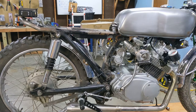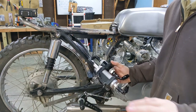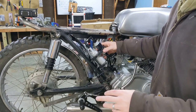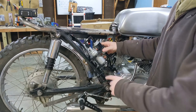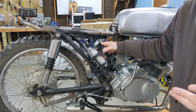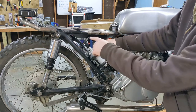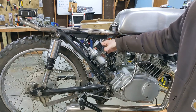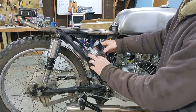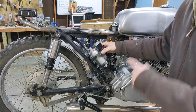Slight change of plans — I was reading the data sheet for this fuel pump last night, which I should have done right off the rip. It says you can mount it horizontally or vertically, but the outlet to the pump has to be pointing up, which seems a little counterintuitive. We're pivoting slightly and mounting it differently, which isn't as clean as I initially intended, but it'll work out fine. We got our tabs made, so I'm just going to grind down the old powder coat on this frame, get those welded in, then move on to mounting the regulator.